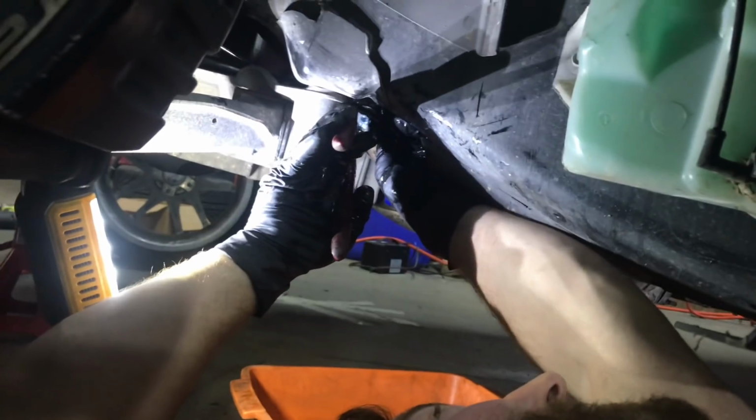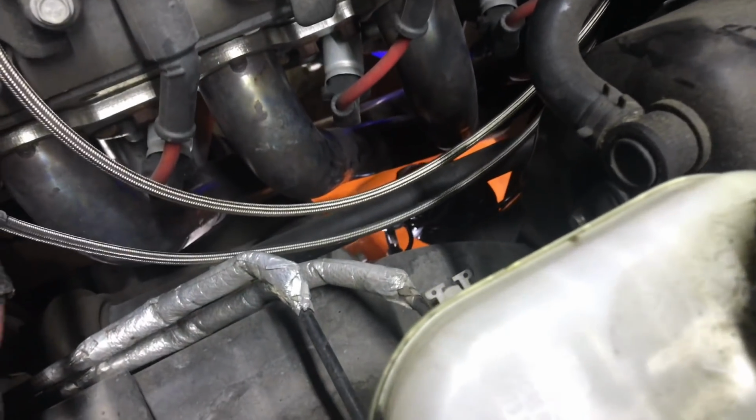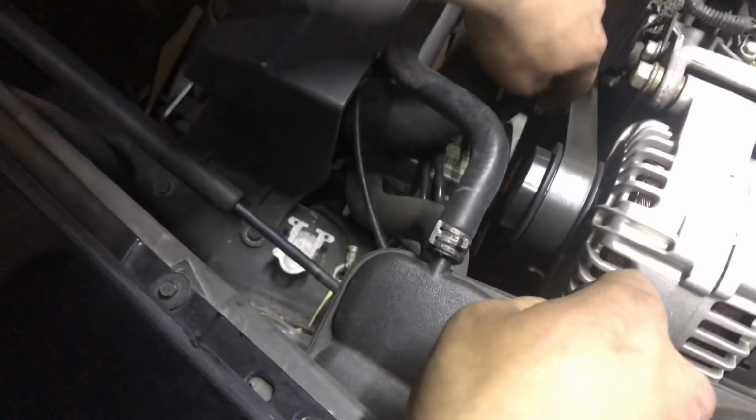I assume he's working on e-brake stuff. I am bending some lines. He's bending lines. Yeah. So we drilled through the firewall. Sick. And then here are the brake lines that are gonna go down for the hydro. Are they gonna hook into the ABS thingy, or what are they gonna do? The ABS plate is up here. So this is your distribution box, and on the backside there's an actual brain for the ABS, which usually on C5s you can take off. Can you pause that music? Oh, I'll get it.